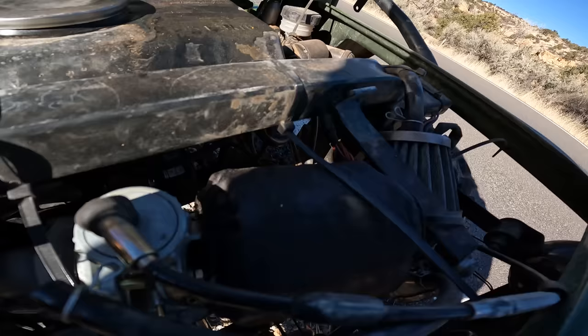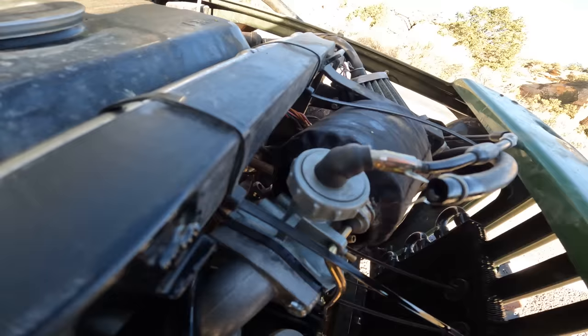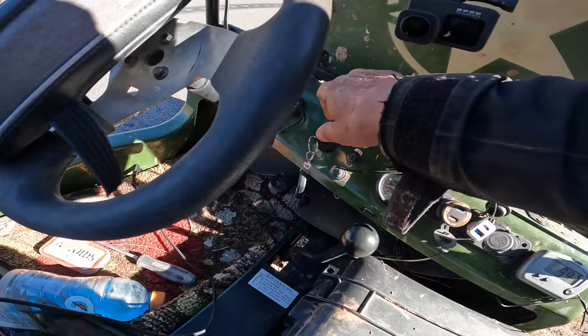And this is done by removing the vacuum pipe from the inlet manifold, and then you repeatedly suck and blow on the pipe until the fuel starts coming out. Give you about 10 suck and blows. Once that's proven, you put the pipe back on the carb and give it 10 more suck and blows. And then...